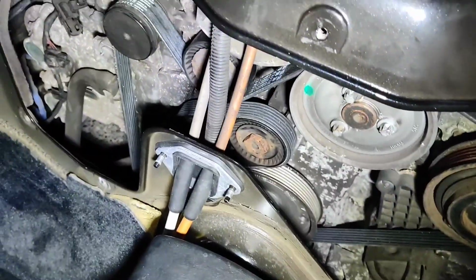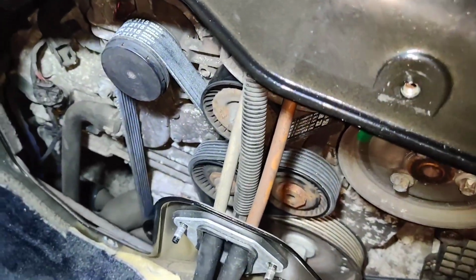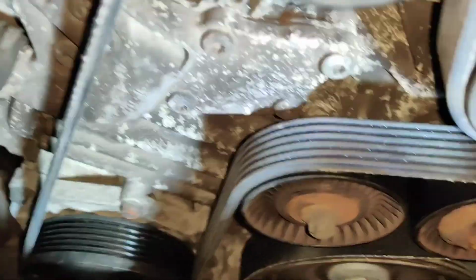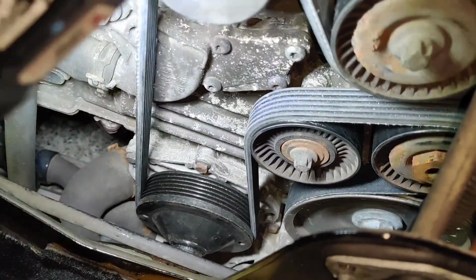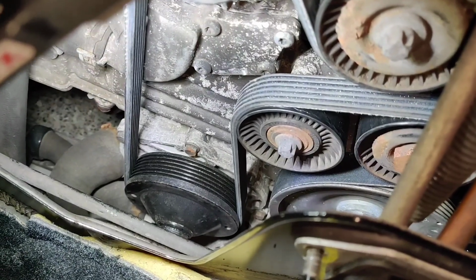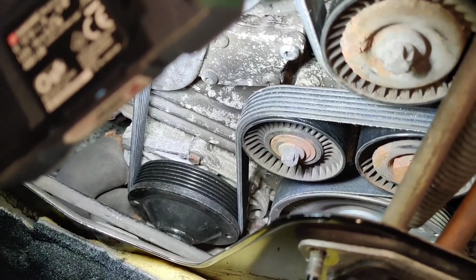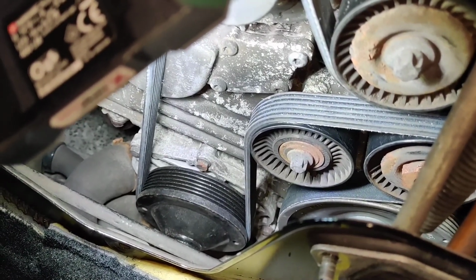Well folks, I am not going to lie, I am a bit of a sweaty mess after doing that. Definitely you need to start at the bottom at the water pulley, and what I found was you've got to be really quite exact, sorry, my hands are shaking a little bit, a bit out of breath, but be exact with how the belt goes around that water pulley, because the side that's nearest to me right now, on the right hand side of that pulley, will dictate how much length or give there is in the rest of the belt for the two tensioner pulleys on the bottom right of the screen right now. So make sure it's around it properly.